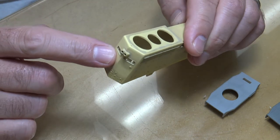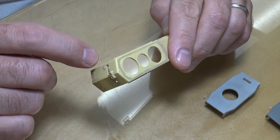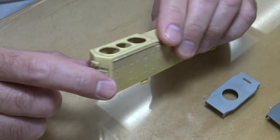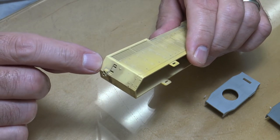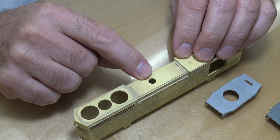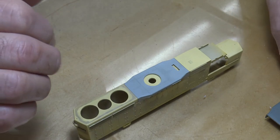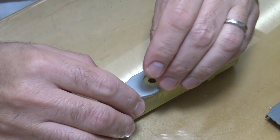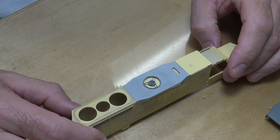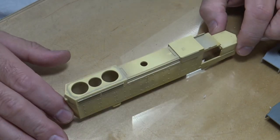And to make it even worse, if you're keeping your NBWs, you have to work around those on this side. So that's really not a fun thing to do. But since I'm replacing all the NBWs, it was easier on this side. This side is okay, but you still have to really cut and blend. So that's the one thing I would change. But everything's done. And then I cut this hole in the top because when you put your cannon fan on, the motor on the bottom of the fan would hit the roof. So cut the hole in there and it'll fit right into it. So that takes care of all of this stuff, and I can get started on the reconstruction.